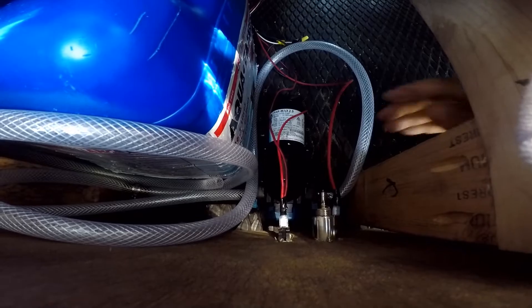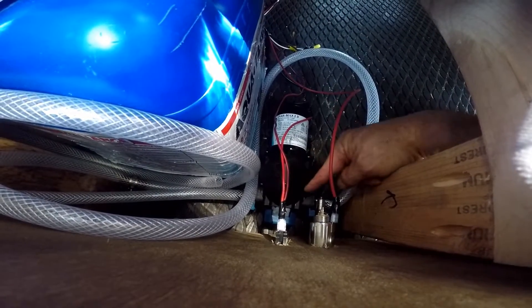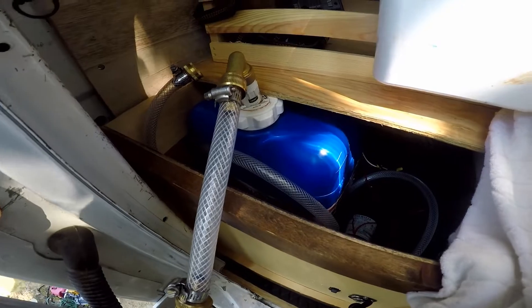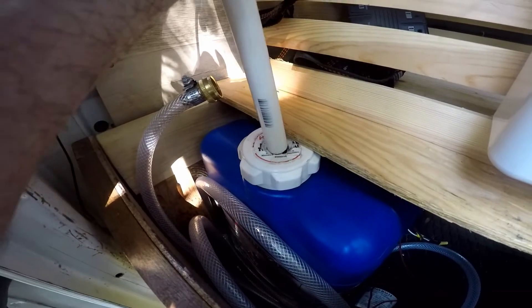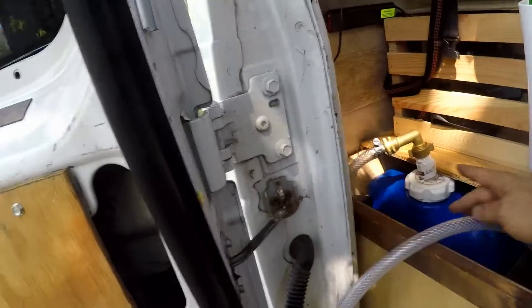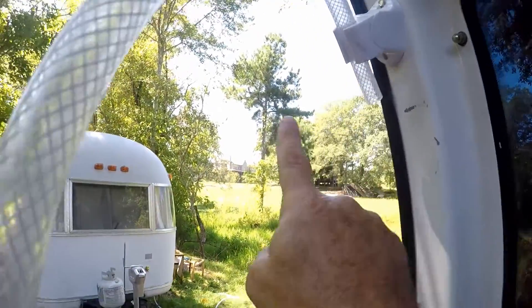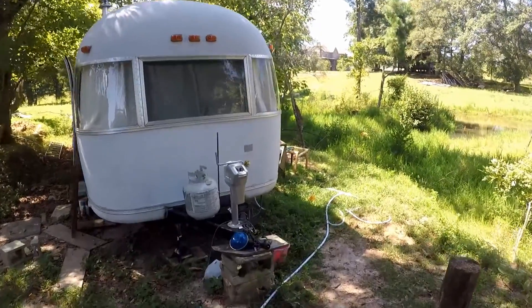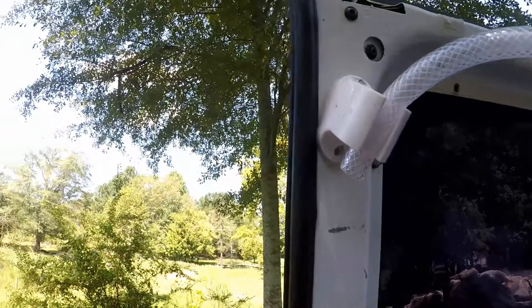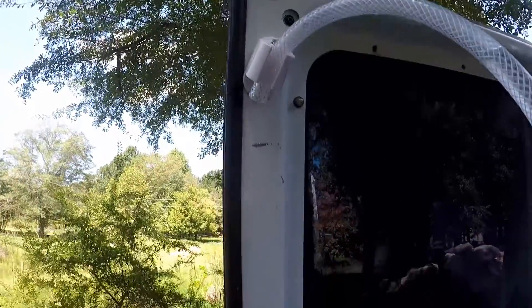The pump down there is a quick-disconnect pump. I can quick-disconnect it from both ends, and I can reverse the pump — so I can pump water into the tank just as easily as I pump water out. Let's turn it on and see if it works. I hooked it back up so it's all in the pump — it's going to pump out here. I'll hit the switch and water will come out here, which will be my water umbilical cord that fits right into the Airstream. It's working fine — I can just hook this up when needed and roll it back into the Airstream.